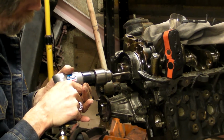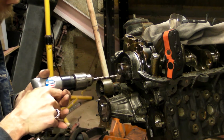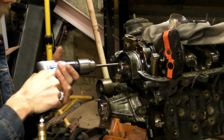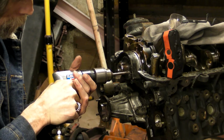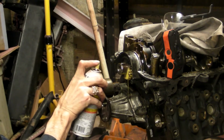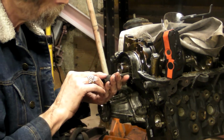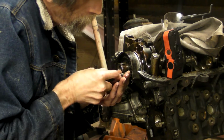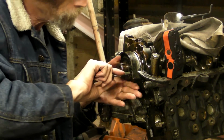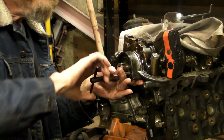And that means drilling the holes larger, and this time we'll be using a 5/16 by 24 bolt to pull this thing off with. The more surface area, more pulling force. Same thing, we drilled the holes in the same location, just drilled those existing holes oversized. I don't remember the drill size for 5/16, but you can look at your tap guide and it'll tell you. Now we're just going to tap them to 5/16 by 24, same as we did before.